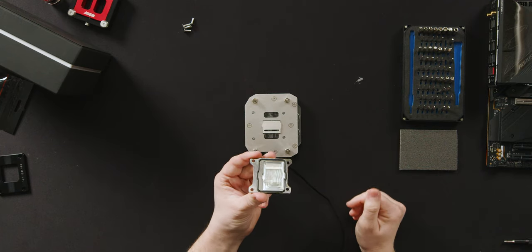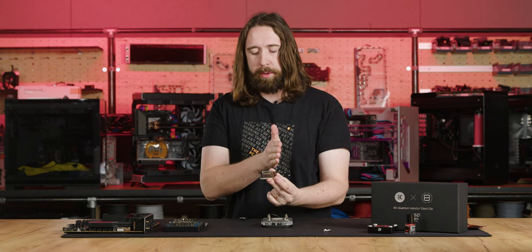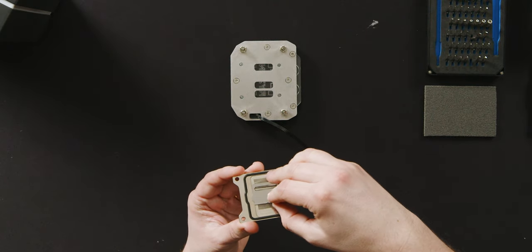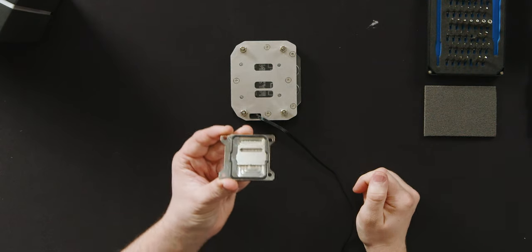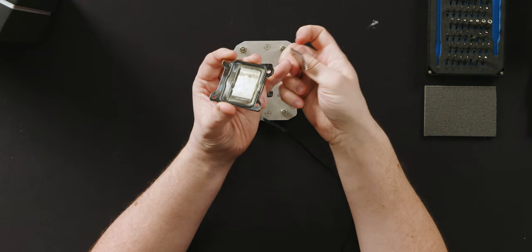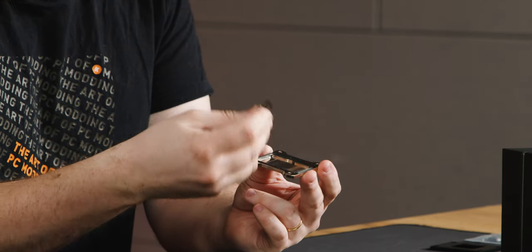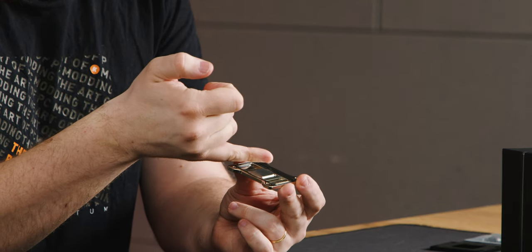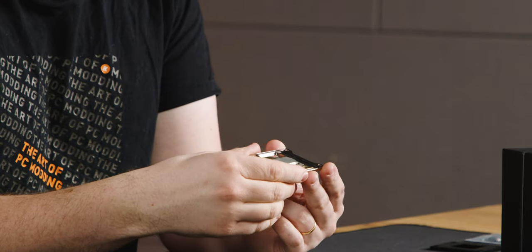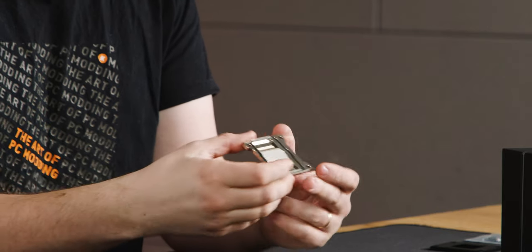The block with a rectangular mounting must always be vertical. Inside the cold plate the block is similarly specialized — the fins are offset both horizontally and vertically so they pass over the areas where the dies are located on the chip. The stainless steel jet plate is keyed inside the cold plate and fits in only one orientation. It has a large chamfer on the inlet to accelerate flow into the fins, and a very short path out towards the bottom and a longer path to the top over the IO die. The orifice through which coolant comes aligns perfectly with where the dies are, so all coolant passes over the dies and splits in half.